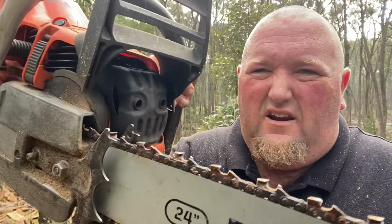Anyhow, oh yeah, simple little fish gill there. Doesn't do much because of the holes in the baffles. If you don't know about these, there's a whole plate in the middle of the muffler, and it's only got 4 really little holes from the factory. I'd say Reese has stuck his drill in there and drilled, I think they're about 5-6 mil holes. It's not big enough. You need at least half the size of the exhaust port in that baffle plate for it to make a difference.